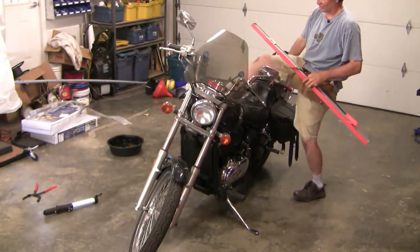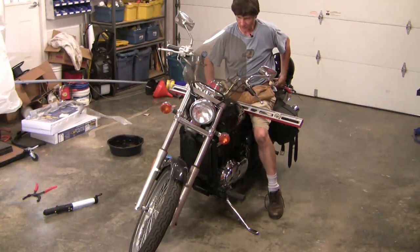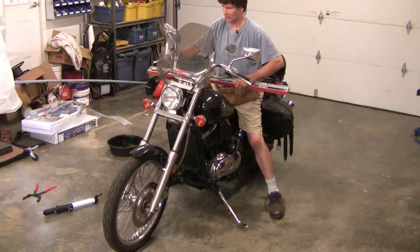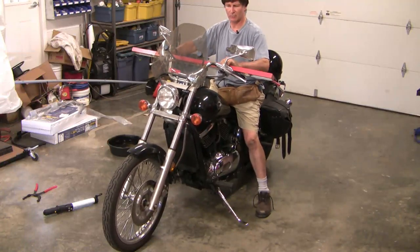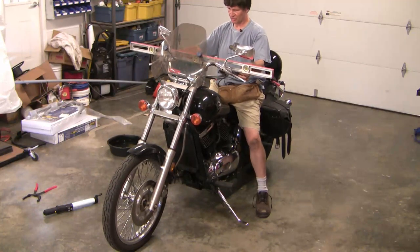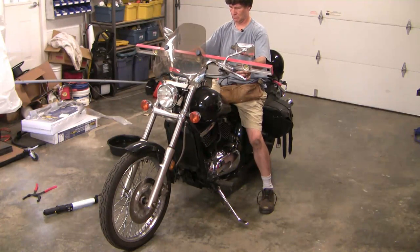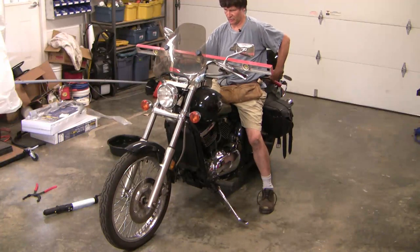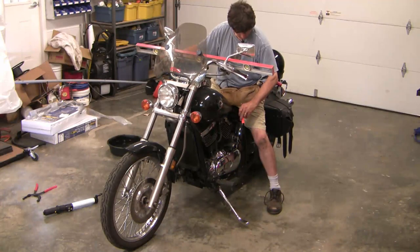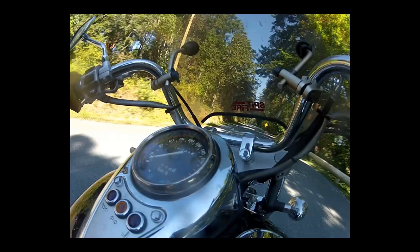Part of the reason I don't like this system is that I like to check my oil level myself and I don't like anybody else to be sitting on my bike, so that puts me into a dilemma. I'll put it upright and set a level on the handlebars until I'm happy that we're in a level position. I'm level now. And then I use my mirror. We're down just a bit — I'm going to need to add a little bit more. Okay, let's stop it there.